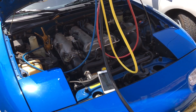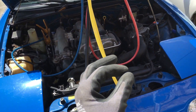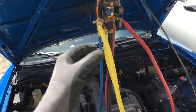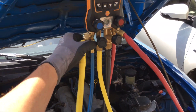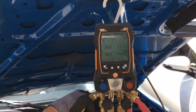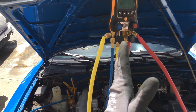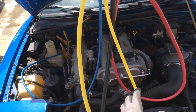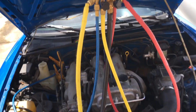I do so many vehicles and I just realized — it really clicked today — that I do so few old vehicles that still have fixed piston compressors. When guys talk about revving up the engine for better efficiency on variable displacement compressors, those just change their displacement at idle. But on a fixed piston compressor, you have to manually raise the idle.